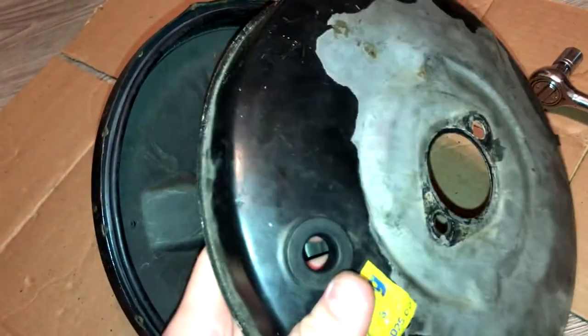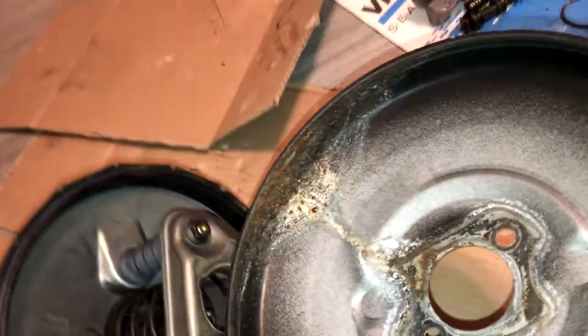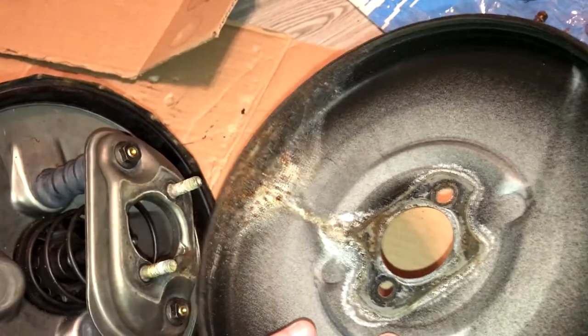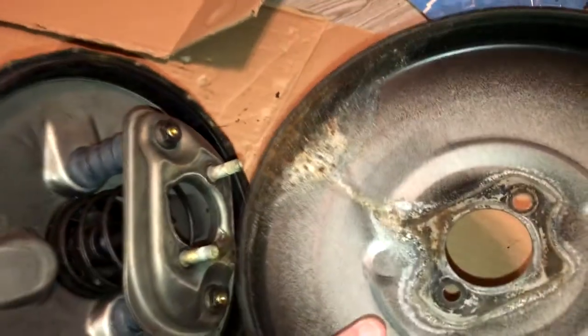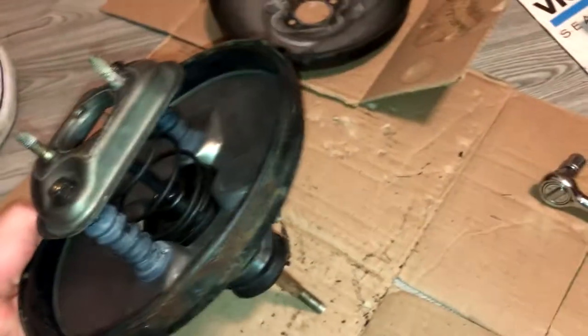It will kind of suddenly lurch out. This grommet is hard as a rock — still sealed but has seen better days. The front plate comes off with plenty of paint missing from years of brake fluid getting by it. That's the first thing I saw. This master wasn't leaking to my knowledge before I took it apart, and I replaced it with a new part along with a new brake booster. There must have been a really slow leak. Brake fluid is hygroscopic, so it does absorb water out of the air — and you can see corrosion got in there.